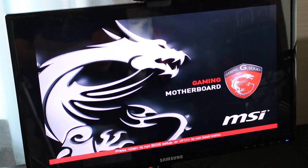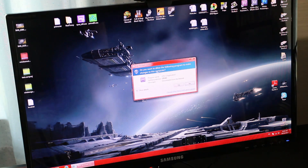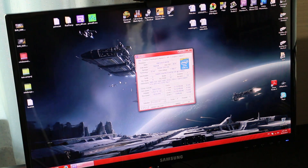Anyway, let's get on to the video where I managed to get this clock. I'll show you the details — it's not exactly a five gig clock on all cores. It's actually five gig on one of the cores, but it's enough to get five gigs, so technically it's still five gigs. We're booting up now and this message will come up because we had a failed overclock last time, but this time it should be okay. It's booting up and onto the desktop. This is five gig on the first core, 4.9 on the second, and 4.9 on the third and fourth. We're going to open up CPU-Z and show you the five gig on Haswell.